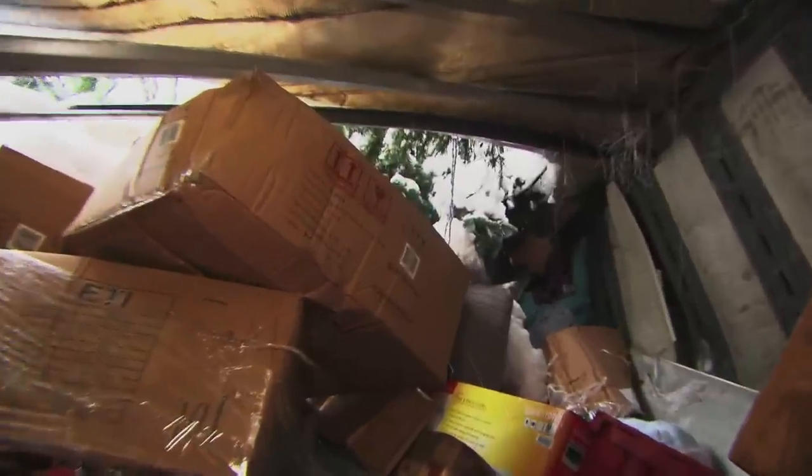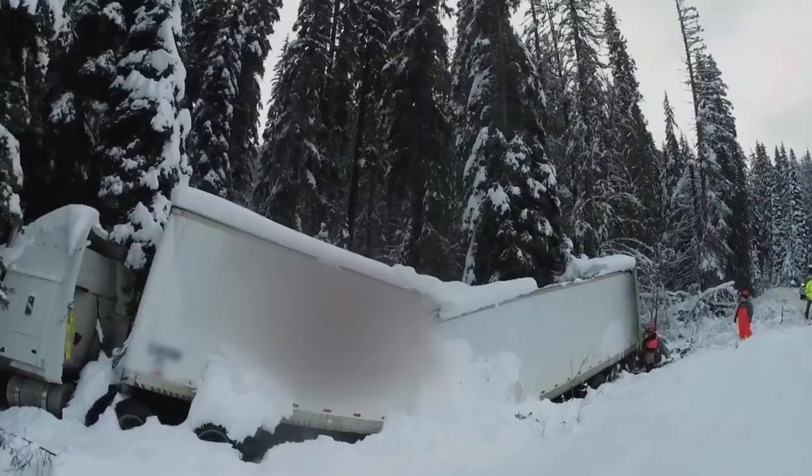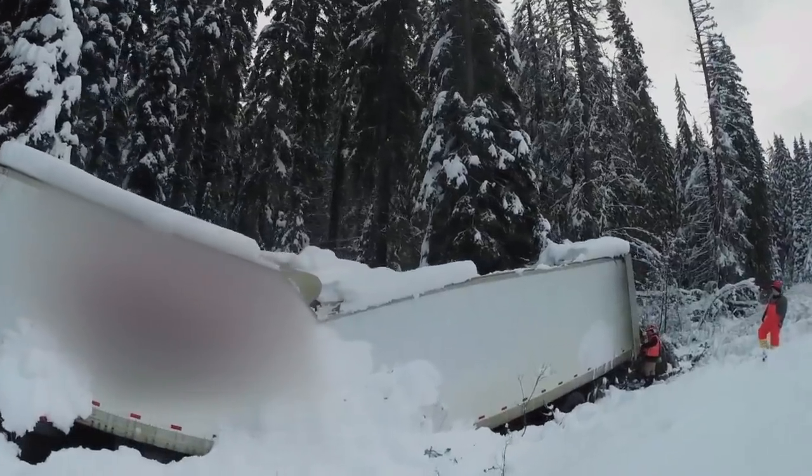So why is that a big problem? One thing about a dry van is that it's very weak. They're made specifically for payload — weight going down on it, but that's about it. The roof has no structure, the sides have very limited structure. The wood on the floor is actually the biggest structural element of the whole thing.